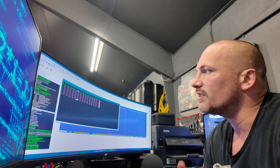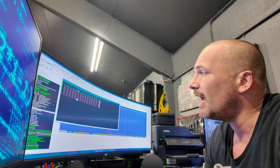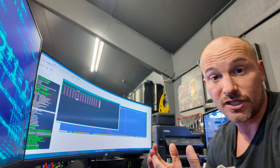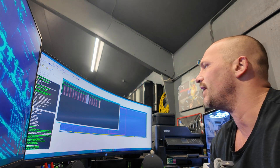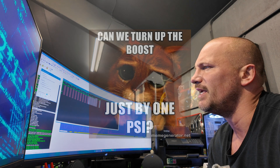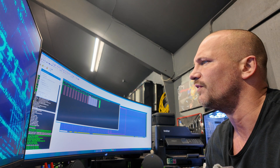With me I have WinOLS — this is on MHD's custom tune. Having a look here, we've got MHD Plus. Normally you'd have a single value boost limiter, but what they've actually done is convert it into a 3D table, which means you've now got boost by gear and boost by RPM all in one place. So once you get your load and torque where you want it, you can make really quick easy changes to the boost. We're going to add one PSI at 5,500 RPM and 1.5 PSI at the higher RPM — nothing too crazy.